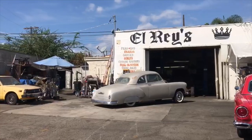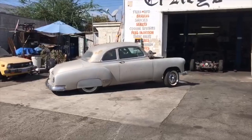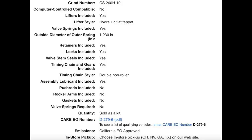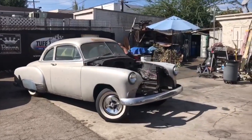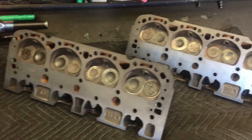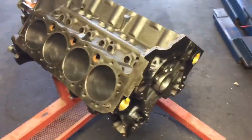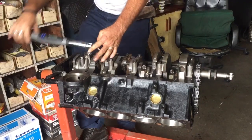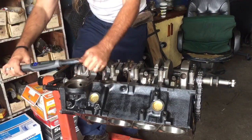Here's a complete parts list breakdown for the Blue Collar 350 budget build. Summit may offer this complete kit at some point to make it easier to order the whole package in the future. After the block, the crank, and the heads came back from the machine shop, they were all clean and prepped for assembly. The first thing I did was install the new freeze plugs, crank bearings, crankshaft, and caps. It's very important to make sure the main bearing seal is facing in the correct position — this is critical. No leaks, you don't want any leaks.